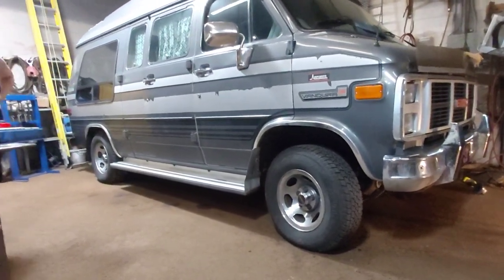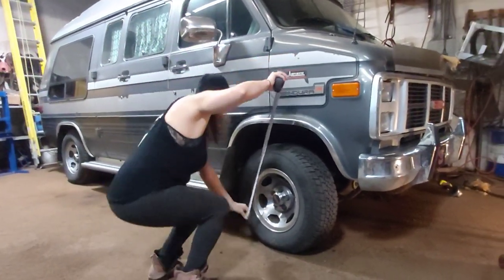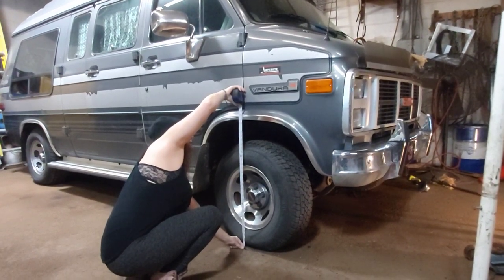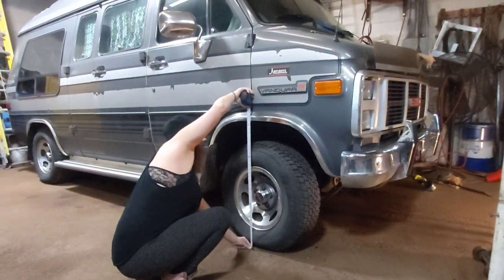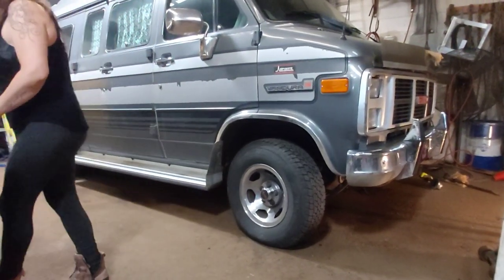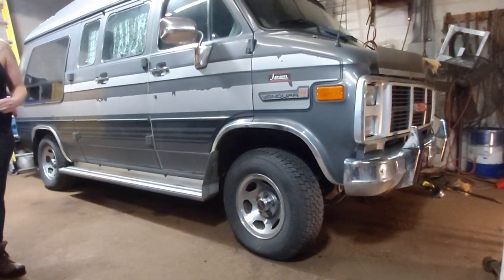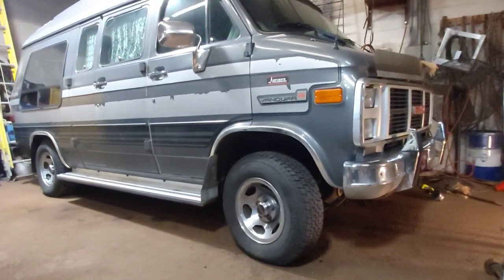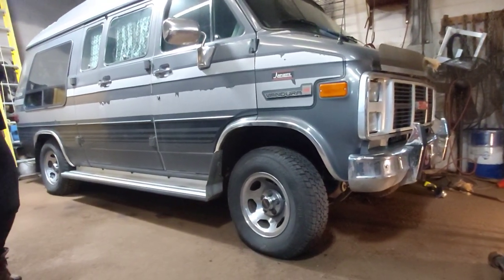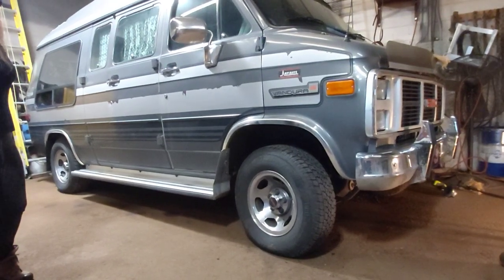Why don't you throw a tape on there and see what we got now. There we go. So we've gone up 2 inches. It said 2.5. I knew we weren't going to get 2.5. I thought we'd get, you know, 1.5. We got 2, or just a hair under 2 inches. So it's definitely going to give us a bit of room for a little bit taller tire, just to get that diff off the ground a bit.